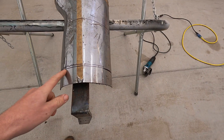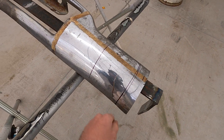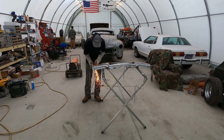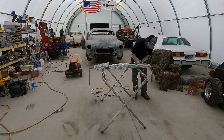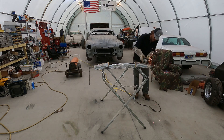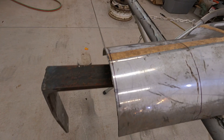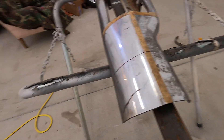I'm getting ready to cut the bumper on the Merc. I had to cut this line and then the same on the opposite side, and then this line here, and then weld up the two pieces. Both ends are cut — just got to clean them up and put a 45-degree angle on both sides and on the ends, then it'll be time to weld it up.